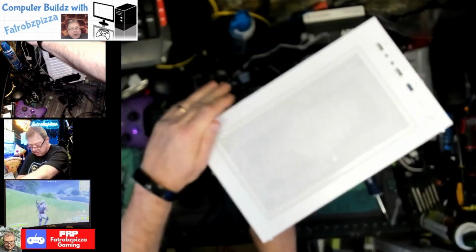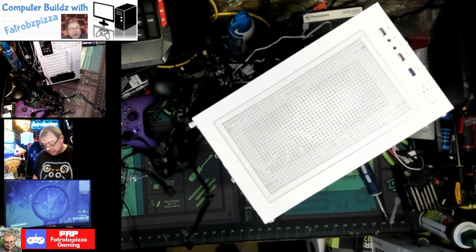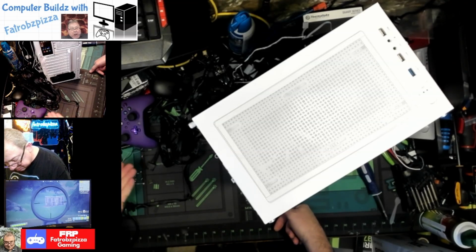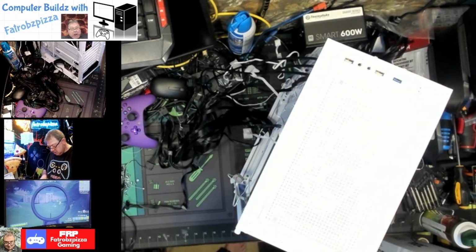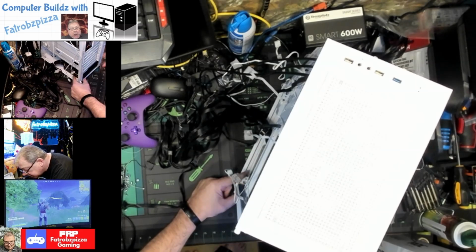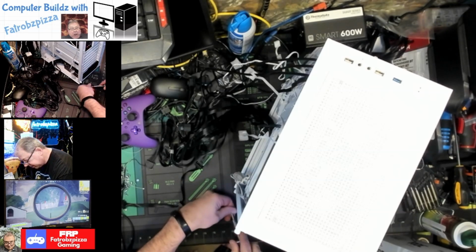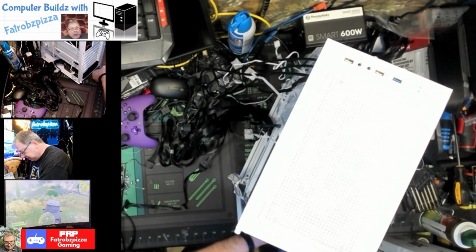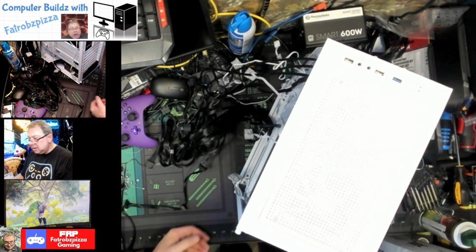You can see that. There's the power supply. And then there's the 1, 2, 3, 4 holes that's going to get screws put in them. I'm going to go ahead and just use these silver screws, hex head, coarse thread that came with the baggie that was sent with us. Being a white build, it'll look nice. Okay, so we're gonna start one and get all 4 of them in, then we'll tighten them up. So it's snug. Down snug. This one's snug. All right. Power supply is in. Snug.